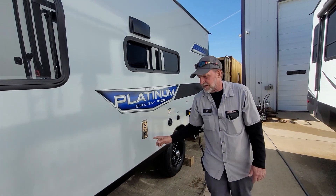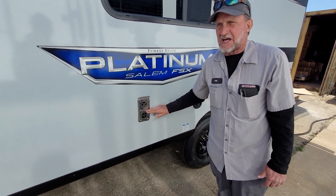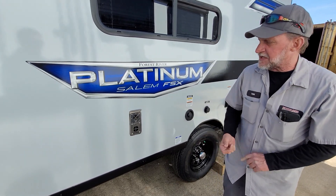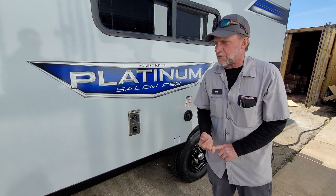As we're coming back, the first connection is the outside of the furnace. It sucks cold air in the bottom and hot air out the top. I always suggest putting a mud dauber screen over the outside of the furnace, for the simple fact that mud daubers like that smell. They go in there, build their little dirt nest, and it cuts your airflow down.